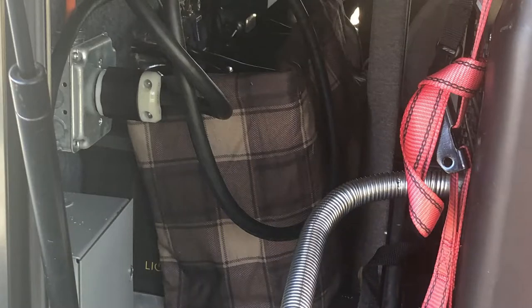I noticed that even when plugged in, the battery still showed dead and wasn't charging. I figured out the breaker to the converter was turned off, flipped it back on — but the battery monitoring system still showed it wasn't charging. This was the one time I noticed the inside compartment under the camper was frozen. To test my theory, I got a heating pad I keep for my back, wrapped it around the batteries, turned it on, and in about 10 minutes the batteries were charging.